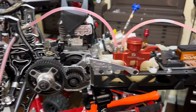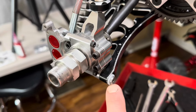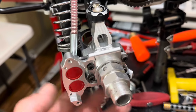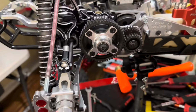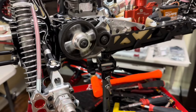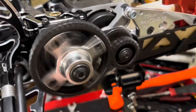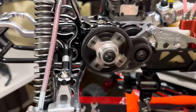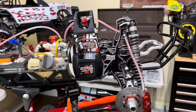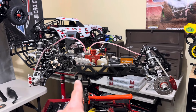Let's go conclude this video - when we come back we're gonna do the four-wheel disc brakes, get those bled and get them working. I got this one taken apart here because I had to configure the hinge pins - you can't use them on this side because it causes the caliper to get kittywampus and you can't fully seat it down on both sides. Just some finagling I'm having to do. However, everything is beyond buttery smooth - look at that. Transmission turns great, gears mesh buttery. Angel should be very happy with that. Getting Mr. Angel's car all nice and tight and right - he's gonna be super happy. Stay tuned guys - remember, tune them right and wind them tight, y'all have a blessed one. Side RC, he's out.